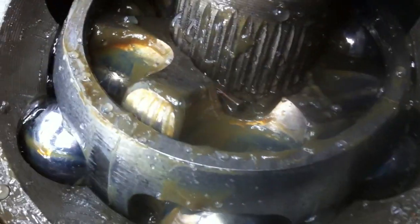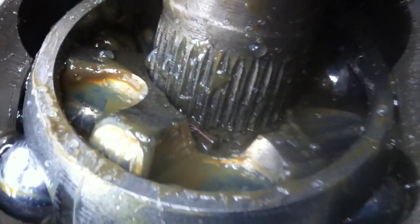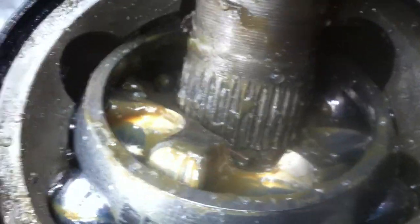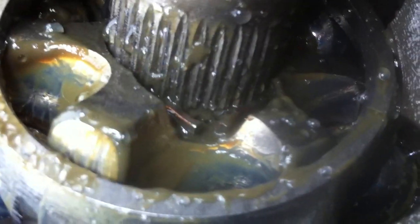I can't find any videos on how to do this on a Blazer, but when replacing these, there's just that little clip in there holding it into the front end and you can just pry it, or keep turning and yanking on it without scratching the one end too bad. Well, it doesn't matter if you're replacing it anyway — it should come right out. This looks like it's the same clip, so I'm gonna try prying these together to get this to slide out.